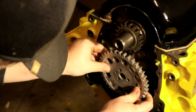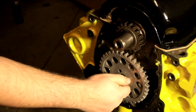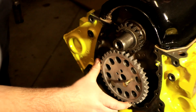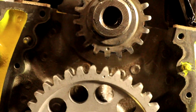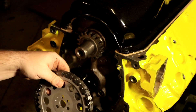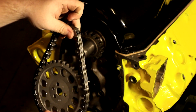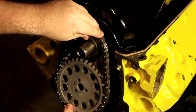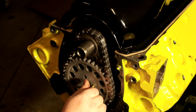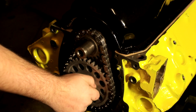Take your gear and put it over the pin. Make sure that it all fits, and you can even slide one of the bolts back into place to ensure that your cam is set to the right spot. Now we can see those two points are facing directly towards each other, which means it's time to put the chain on. Lay the chain over your timing gear like this so it's kind of facing up, then hook it around this part here, and your pin should slide right into place. Take your bolts, fit them in, and bolt them down to the torque spec — that's really it.